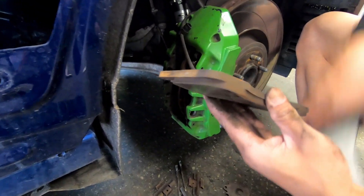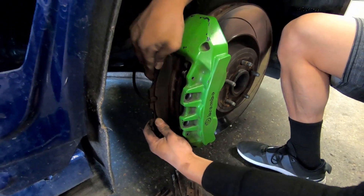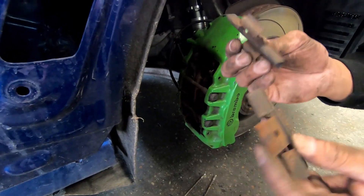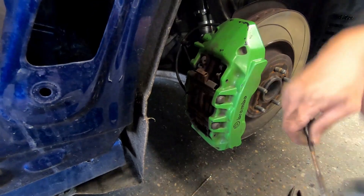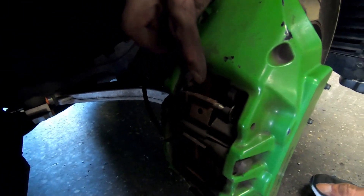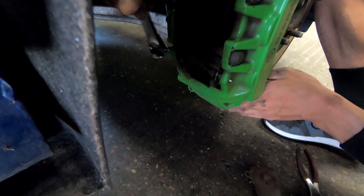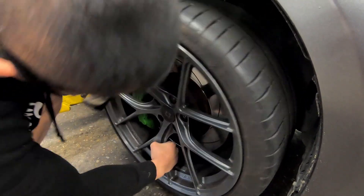Now time to put everything back together. Put the pads in and reinsert. You may need to push the pistons back to make space — just use your hands. Voila, problem free. Now we gotta get the back side — push the caliper pistons in, grab a titanium shim, put it in the back. We have it in. Put the sensor wire back, then put the caliper bolts in. Be careful not to scratch your paint if you have a painted caliper. Tighten down with the 13mm, put in the brake pad retention brackets, and reinstall the cotter pins.